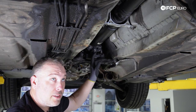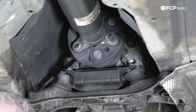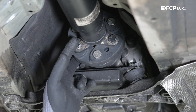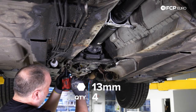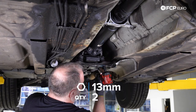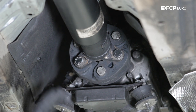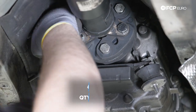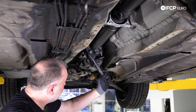Right now we're going to focus on unbolting the drive shaft from the transmission. I'm going to remove the transmission crossmember — it's only 13 millimeter bolts and nuts, super simple. We're going to remove that first, and then we'll have access to the nuts that secure the bolts to the output flange of the transmission. When you're doing this, everything is going to kind of droop back — that's totally fine, it's not going to go anywhere. This has a vibration damper here. I'm going to loosen up the 13 millimeter nuts for the transmission mounts and just slide that out of the way to give myself a little bit of extra room.